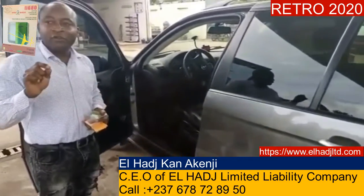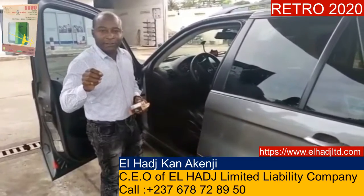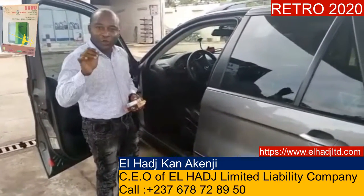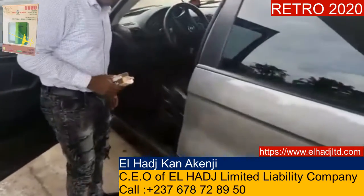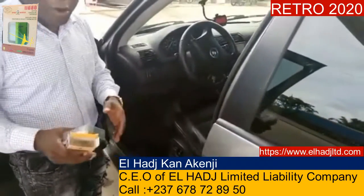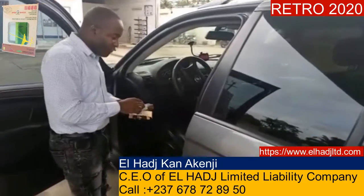You simply have to locate the OBD2 port. The OBD2 port of most cars is always situated slightly above the pedal, or for some other cars, such as American cars, by the steering wheel.